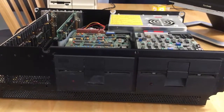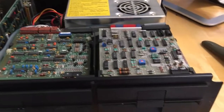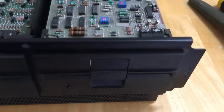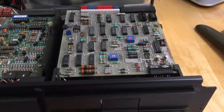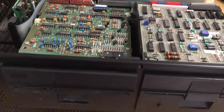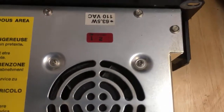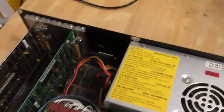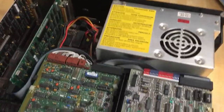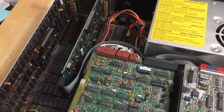I've already got the top off of it, and you can see it really looks quite a bit different in some ways than modern machines. This is your 5.25-inch floppy, and back in those days the CPU didn't really do that much — controlling hard drives, floppy drives, things like that — so they had these huge boards on top that basically have their own microprocessors. Things have changed quite a bit since then. You can see the power supply is only 63.5 watts. If you wanted to run a hard disk in one of these things, you had to get a beefier power supply.